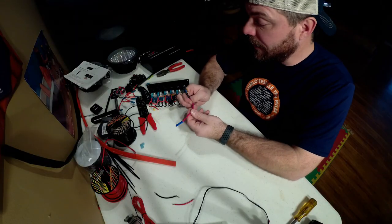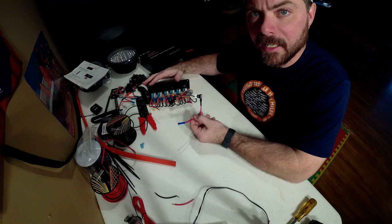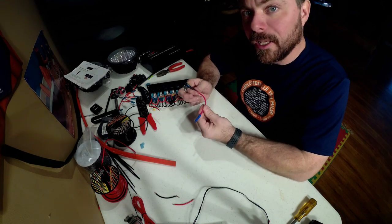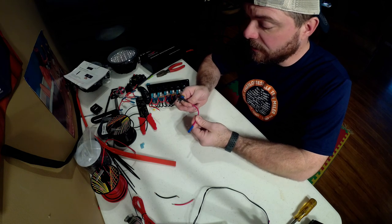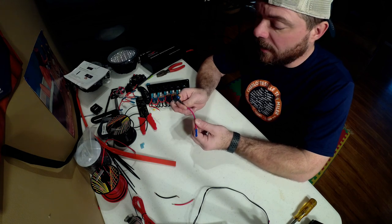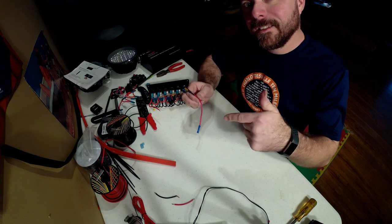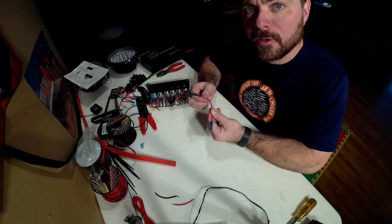I'm going to use this in my install to wire it so that the lower level LED light on my switch panel turns on when the ignition turns on. These are exceptionally cool because you don't have to end up splicing into any wires under your dash, which is going to increase the reliability of your wiring, and if you ever want to remove it or change something you can pull this right out. There are a bunch of different versions you can get on Amazon — I'll put some links in the description below. Hopefully these will help you out on your next wiring project.